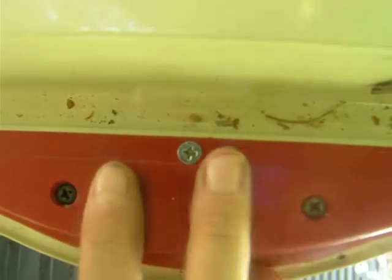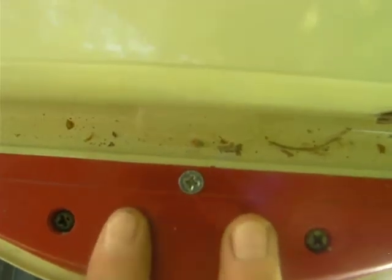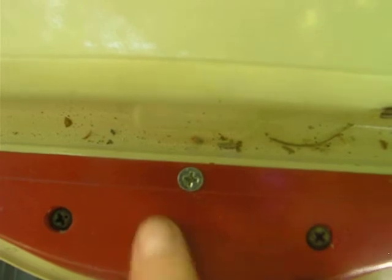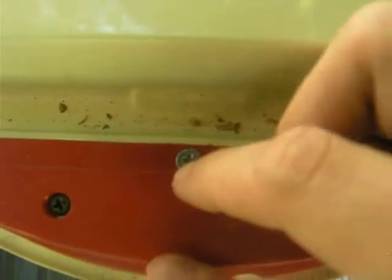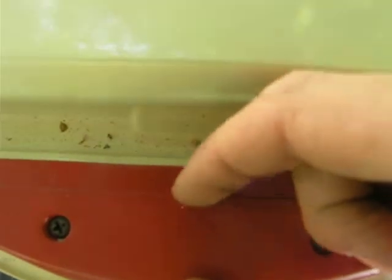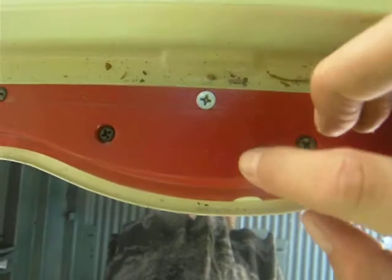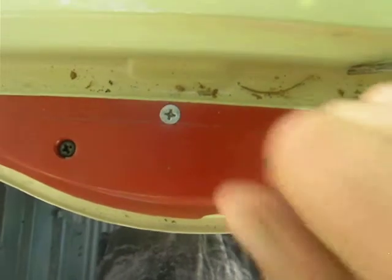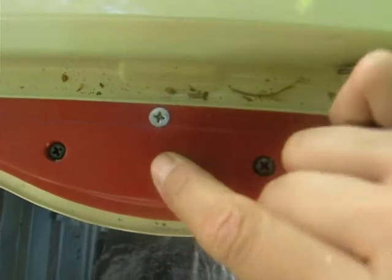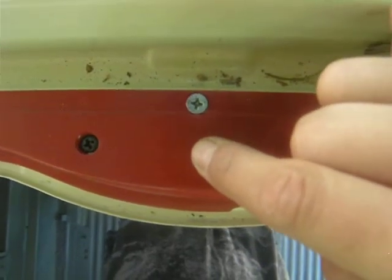There's a square plate that goes on the bottom. Then there's that gear that goes on top. And then there's a spring plate inside with a hole and it has two lips. The lips go this way and this way — it took me forever to figure this out. You've got to kind of take a rubber mallet and beat it down so it holds tight against that gear and the springs. And that's the way that works.